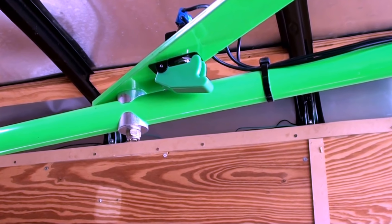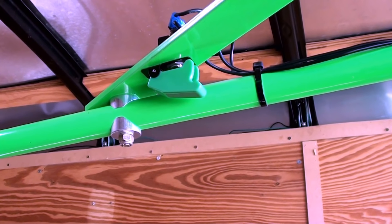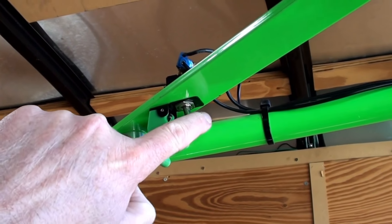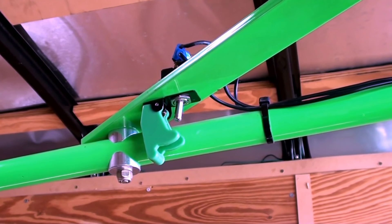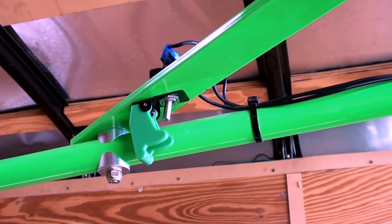Here's a real handy feature — it's actually a safety feature — and this is a kill switch for the instructor. You pull the switch down and click this toggle, and what that does is it cuts off your mags and kills the engine. That way, if the student forgets, you're not going to have a chewed-up parachute; you'll be able to kill the engine before that happens.